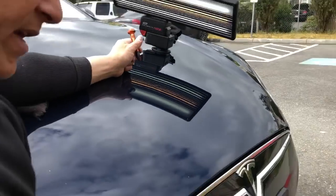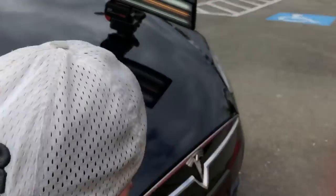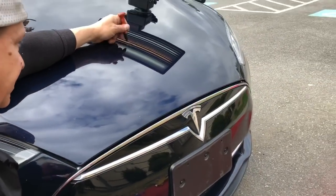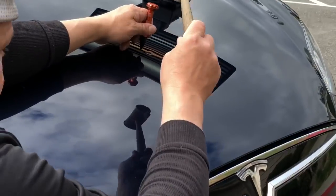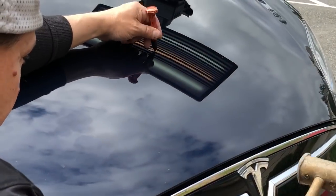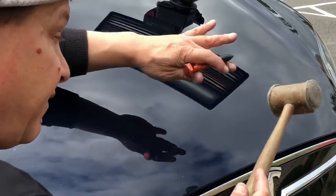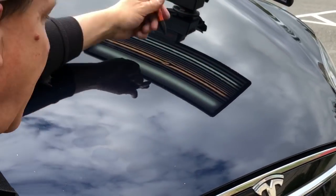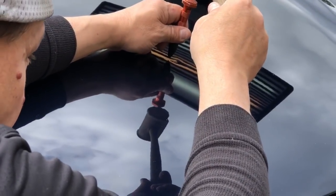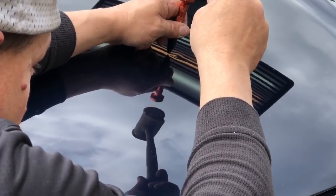There's some very in-depth stuff right there. When I say the back of the dent, that dent had a back line, the body line to it that was just stiff and held in. Basically what we have to do is break its back, cross over that line so it flushes out and smooshes out and flattens out. Otherwise it's just going to keep on getting more and more creased and go backwards.